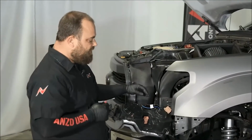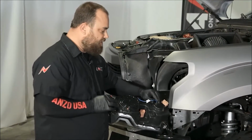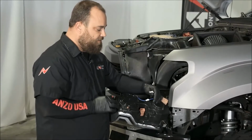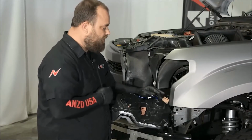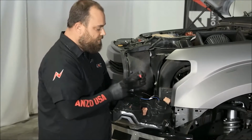installed. Okay, so with your new light, in order to hook up the switchbacks to your turn signal, you'll need your turn signal connector, and then these two wires. They are labeled. Blue is power, brown is ground. And what I'm gonna use are some Scotch locks.